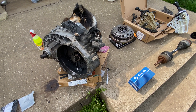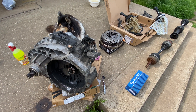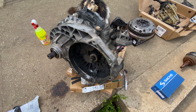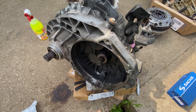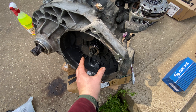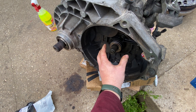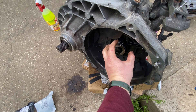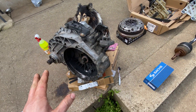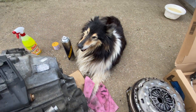I'm not 100% sure which code is the long or the short variant. Generally, if you do this swap you need to remap your engine, because it's not going to cope well with the long gear ratios. First you need the gearbox, and you're going to need a throwout bearing. Whenever you replace a six-speed, you basically need to replace the throwout bearing — it can collect dust during use, and when you remove the gearbox from the engine this bearing just comes out completely. The shaft has dirt and dust inside the bearing, and once you reassemble and use it, the dust will wear out the seal and throw the hydraulic fluid that operates the bearing. So whenever you remove a six-speed and reinstall one, you need a new throwout bearing.